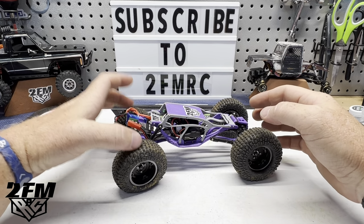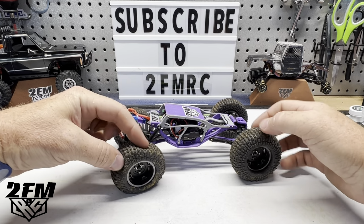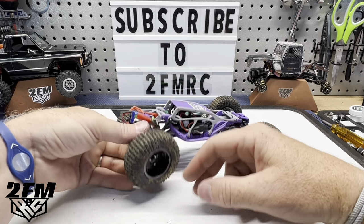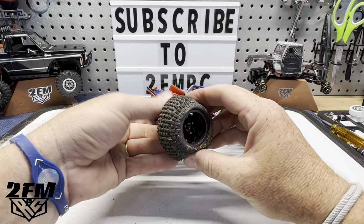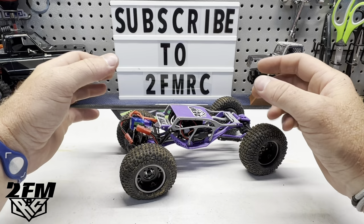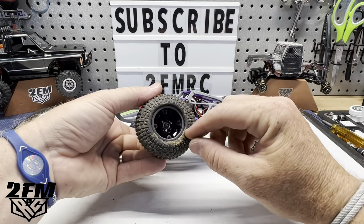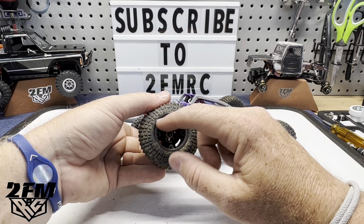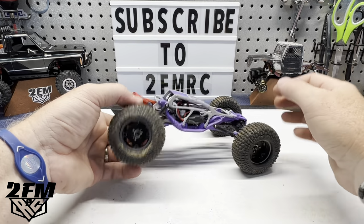I did put the FMS brass inner rings in the front with soft foams and the stiffer foam in the rear. You can see I'm getting a lot of tire slide or shift there, and so I'm getting all of this bulge out the side. That's the issue I have with a lot of the wide, deep wheels. I think I just need to maybe cut a little bit more of the inner beadlock ring on the tire, because I did cut these to fit the 1.2s a little better.